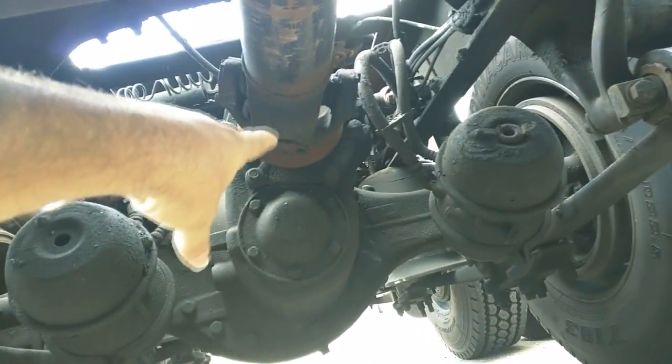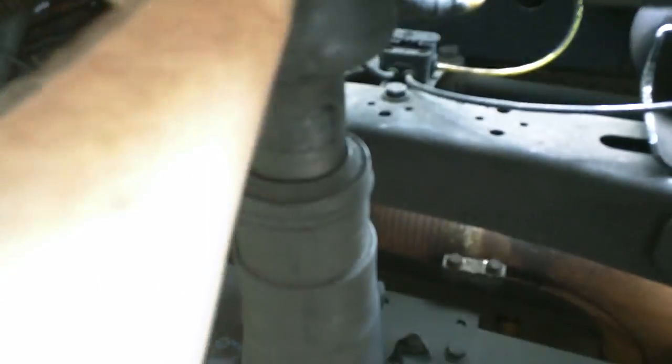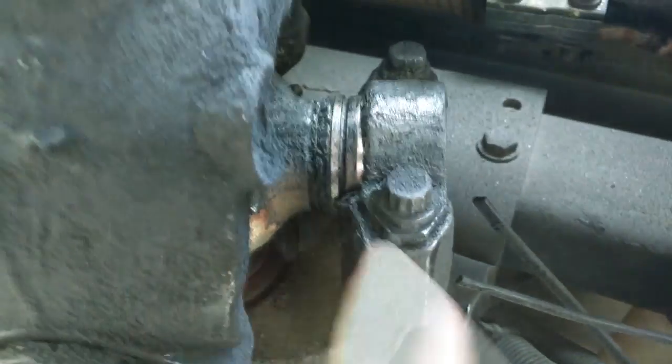Here's the drive shaft — I gotta take it apart right there on that U-joint. So basically the problem is right here, at least in theory. The spline here has play — let me see if I can show you guys. It's not very much play, so I don't know. The bigger problem I have is right here — you can really see it. I'm going to take it apart because if that thing is all destroyed, maybe that's just my issue. That bearing — or that cap, I should say — is spinning in there, and that U-joint. So I've got to take all this apart.